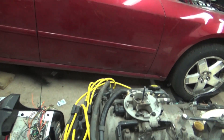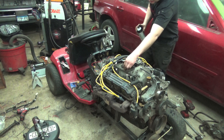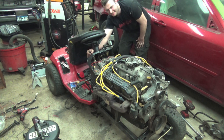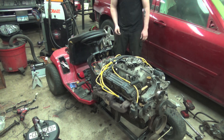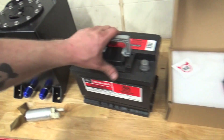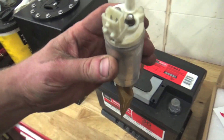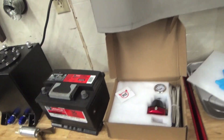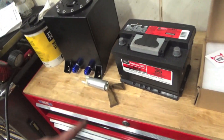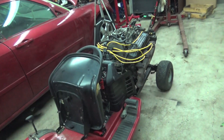So that's scary. Now we're going to shoot some carb cleaner down the throat of this thing and see if it'll fire up for a few seconds. That's really scary. We've got to find a place for this two and a half gallon fuel cell, a battery, and an Evil Energy fuel pressure regulator that we're going to be running off of this little pump right here. If you guys want to pick up these Evil Energy fuel pressure regulators, the link will be down in the description. Let's first find out if this battery is big enough — it's about 590 cold cranking amps to crank over the 5.9. We're going to get it in place, vice grip it in, and see if it'll crank the 5.9 over.